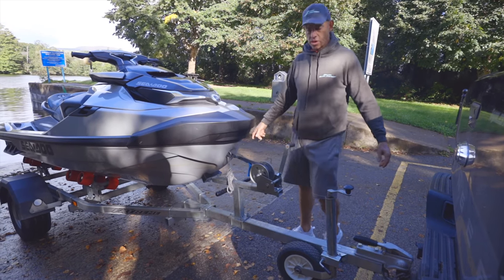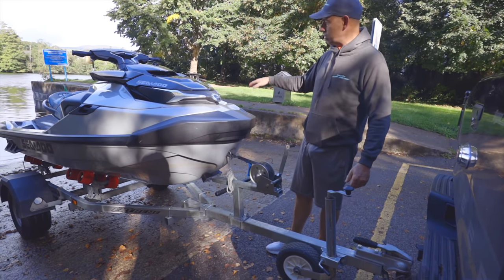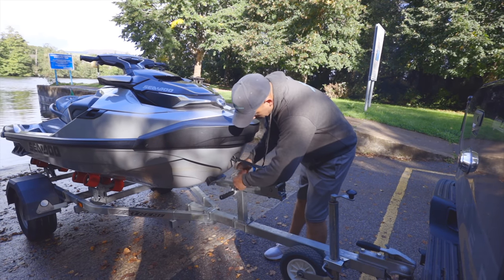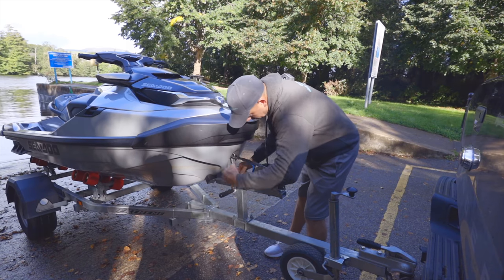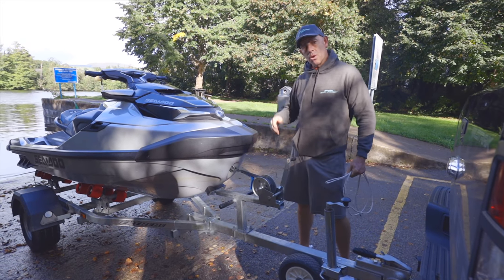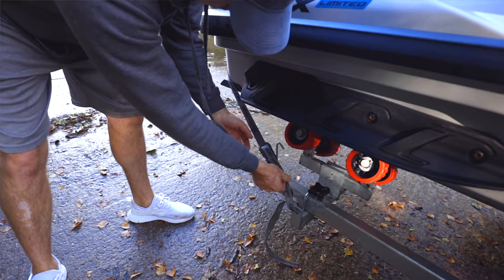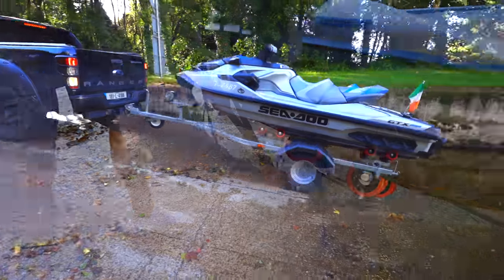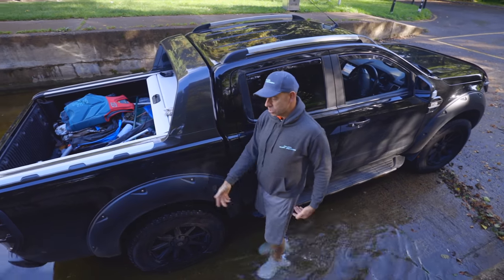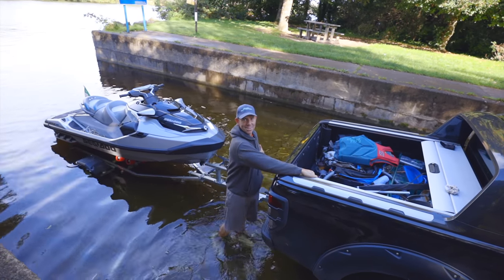At the slip and ready to launch. Take your straps off now — if you have a roller trailer and you take all the straps off before going down the slip, your ski can end up sliding off before you get into the water. Take off your back strap and your safety strap. I'd always advise keeping your ratchet on as you go down any slip, even if it's flat — once you're in the water you can loosen it off and your ski will go off safely. Take off your ratchet strap and safety rope at the front but leave your winch on. Watch out — these slipways can be slippery, so take a walk down nice and handy and hold on to something.